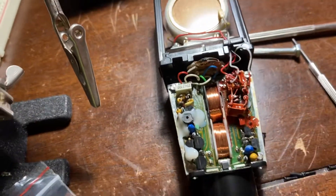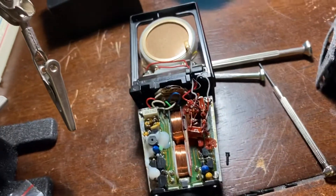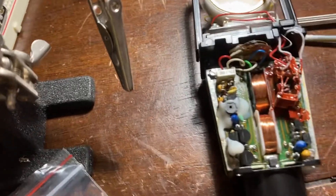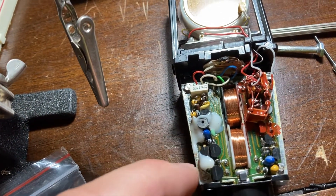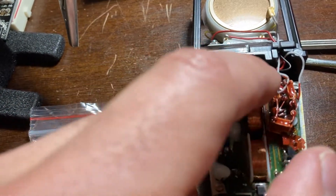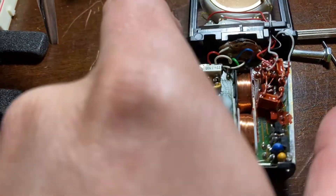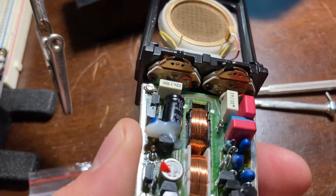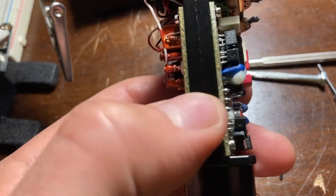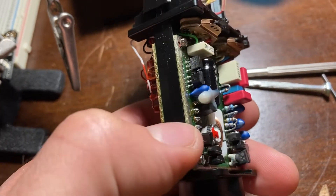The other tricky part was just figuring out the procedure of how to take apart the whole thing. The obvious stuff first — there are the bigger screws and those three little pieces of plastic. Once I was inside, I found that the way to go was to first do the little screws, then the big four screws, and then there's a set of pins that are holding the two PCBs together, so you've got to pull that apart to separate the two boards.